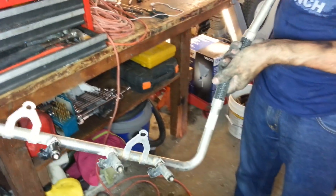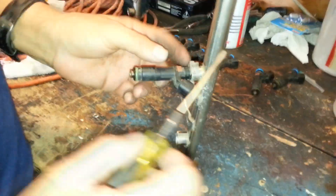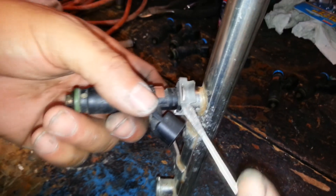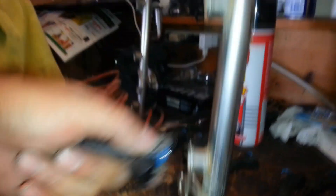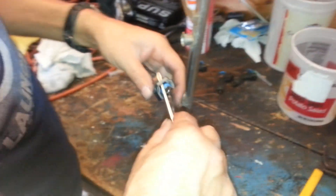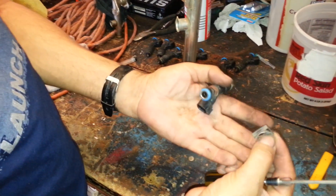This is your fuel rail right here and these are your fuel injectors. This is the way you remove the fuel injector off of the fuel rail — it's got this little lock clip right here. It's locked right here, so all you do is stick the screwdriver behind it, lift it up, fold it out, push the other one out, and jiggle it out until it comes out. Then you need to remove this clip — just stick your screwdriver in here and pull it up and it comes right out. Put it in a safe place because you're going to need it to put it back together.